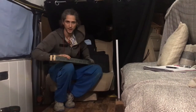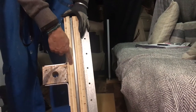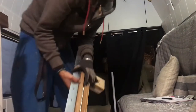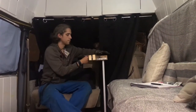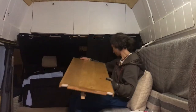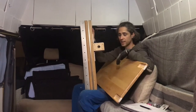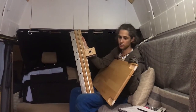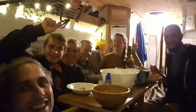It's go time! So just before we attach the table to the mechanism — if anyone wants to build one — what we've got here is a place for our table leg to slot into. That's attached to this and then there is another mechanism which slides out. When the table is over here you can use it on this side or on that side. You can turn it around and also slide it out and use it along the edge over there. It needs to be secured on the ground properly. You can have a nice extendable table — you can even put a second piece of plywood underneath and have the extension come out over the lower piece. So you could easily fit a table of four or five people along a van like this with that sliding mechanism.